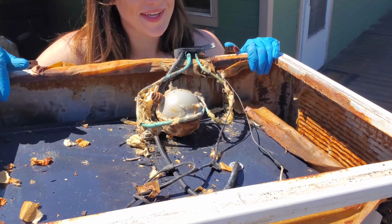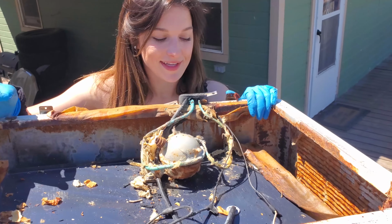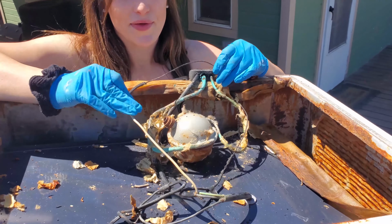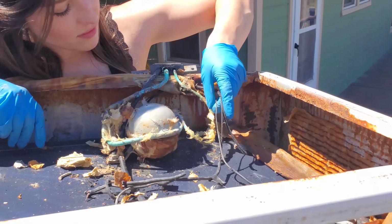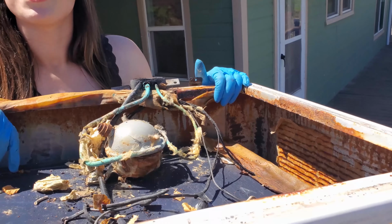The guy we got it from said that if you touch the fridge, it would kind of shock you a little bit. And he's like, oh yeah, you probably just need to ground it to the floor or it needs a new wire. These were the wires that were under the insulation there. Bare wire. That was just starting to melt through the insulation. Glad we opened that up.